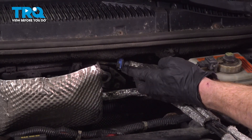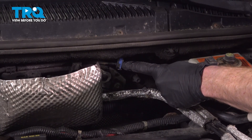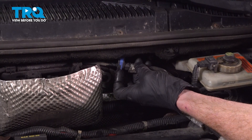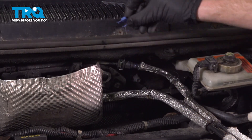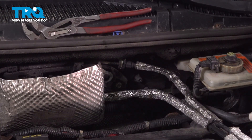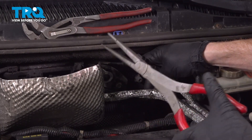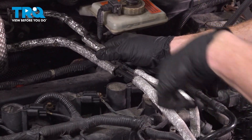Now we need to make our way along the backside of the engine up to the firewall. Just underneath your windshield cowl you're going to find a fuel line that makes its way up to this little blue connector. For the connector along the front and the back there's a little lip that you can grab onto. Gently pull it away and lift up at the same time. This will be easiest if you grab both at the same time, pry them away and lift it up. Once that's lifted up, set that aside. Once you have the blue tab out of the way you're going to find a press tab right under here. To squeeze on this you can either use your fingers or some skinny long nose pliers. Gently squeeze and it should want to break free. Once it does, carefully pull this off to separate it. Now let's follow that line on top of the engine. You're going to find a plastic clip that holds this in place. Let's lift this up and out of its position.